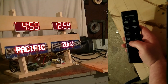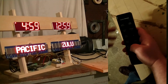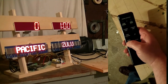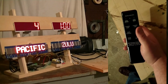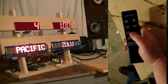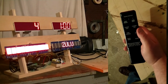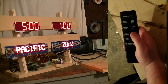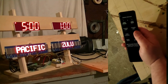When I release I press timer control one time. When it gets to four I release and then timer control one time. It'll take several seconds and then should go back to the time. Everything looks good — that is the whole process of changing time zones using the infrared remote.